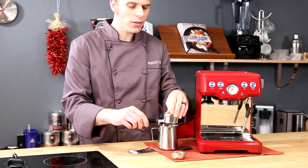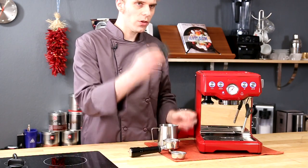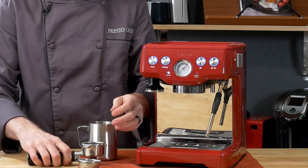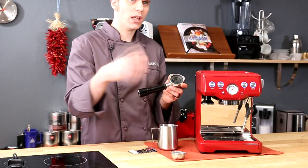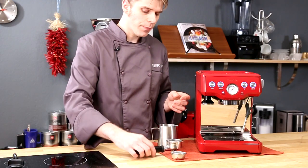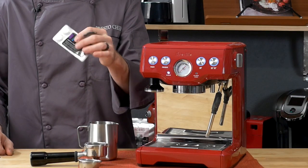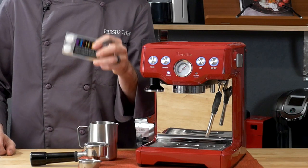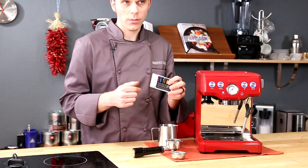Your basket is going to go into your portafilter. Click that in, and next you'll need this rubber stopper. This rubber stopper is going to go into the filter basket. This is going to help water to backflow into the machine and thus clean out the innards of it. Really important next is going to be these cleaning tablets. You're going to get a couple of these with your Breville Espresso Infuser, and they're going to be important for properly backflushing the machine.